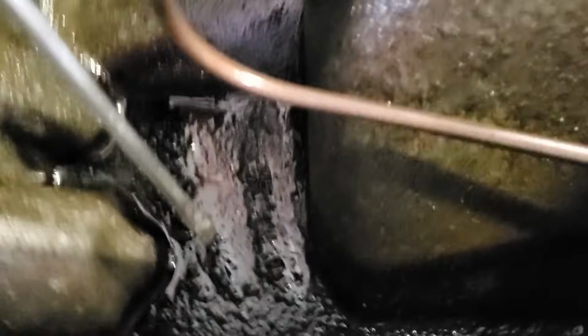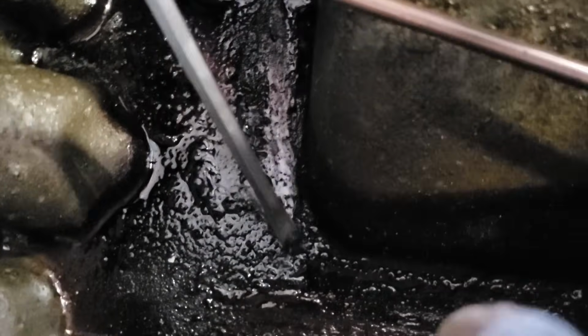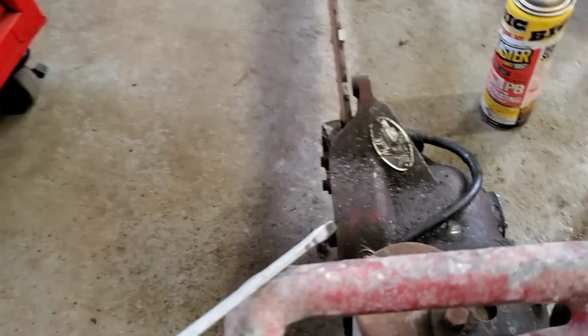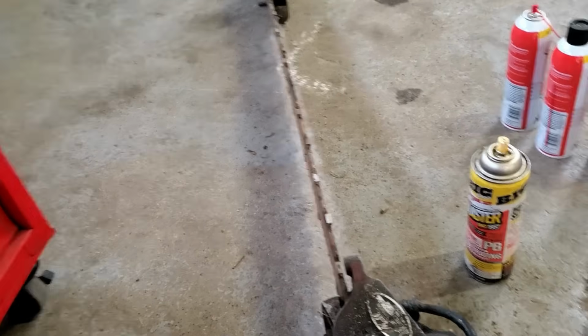So what actually happened is somebody left fuel in the tank, and I took the thing off, and I didn't show you guys. I'm sorry. I've been cleaning it out with rags, but this is pleasant. That's what you want in your fuel system, just a nice gabagoo. I'm going to clean that out and clean my carburetor up and put gas in it and see if it'll come to life. We got it to fire up a couple times, but it's kind of being finicky, just like all chainsaws are.